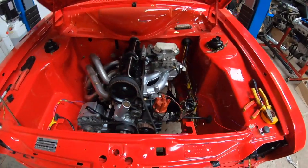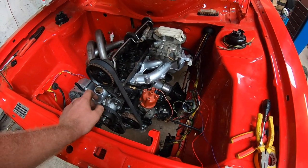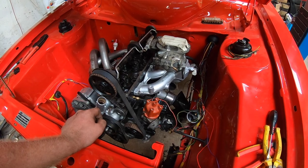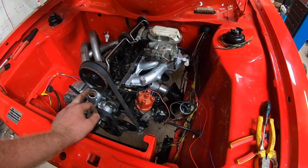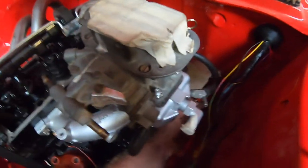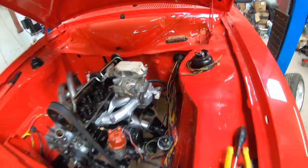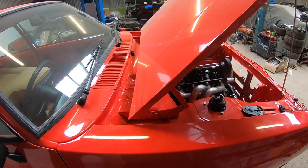So, next stages of this, hopefully tomorrow, will be to get the power on. I need to make the battery cables, mount the battery underneath the seat or whatever. He's putting one of those Odyssey solid state batteries in, so it's safe to go in the cabin. So with one of those to put in, I have the battery cable already all fed through, so just need to cut it to length, which it sort of is really, and put an end on it, put it on the starter motor. I'll take you underneath and show you just the bell housing and stuff and go from there.